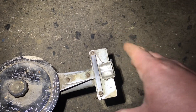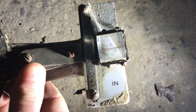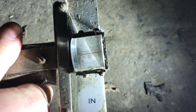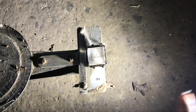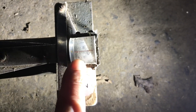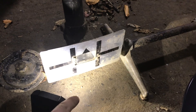This side here is for wheels pointing out. We want a little bit of toe out on a front wheel drive car. After readjusting the light, you can see the gauge is set up - this is toe in, this is toe out, and there's zero in the middle. We try to look straight on and find the angle, hoping for something very close to zero with a little bit of toe out. On a front wheel drive car we want toe out; on a rear wheel drive car we want a little bit of toe in. The Audi TT is a front wheel drive car even though it's quattro, so we want a little bit of toe out.